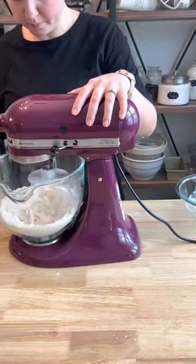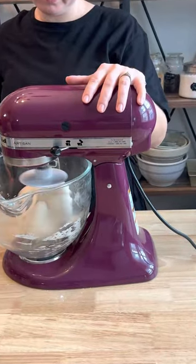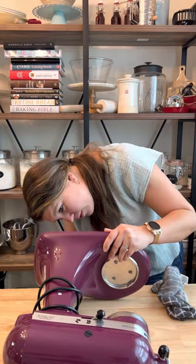If you are using a tilt-head mixer, you might notice that kneading bread beats it to heck sometimes. There is a fix for this. Flip the mixer over and look down the mixer neck — there is a screw all the way down at the bottom. Grab a flat-head screwdriver and crank down on it.